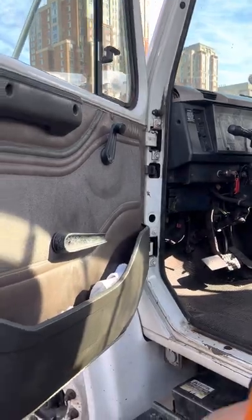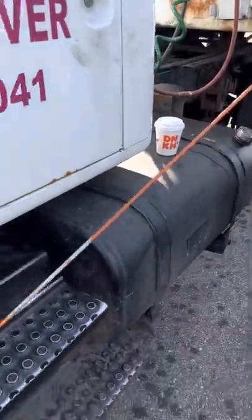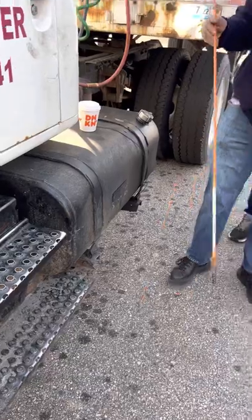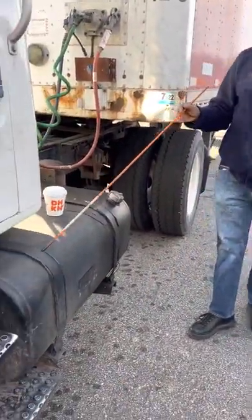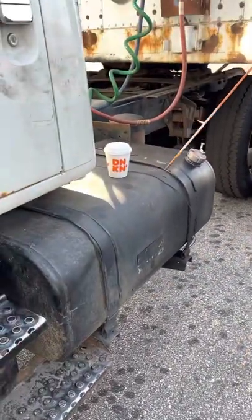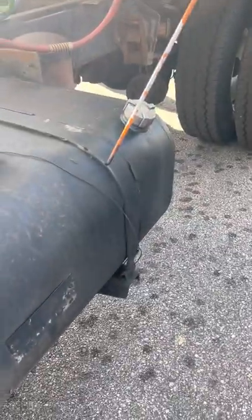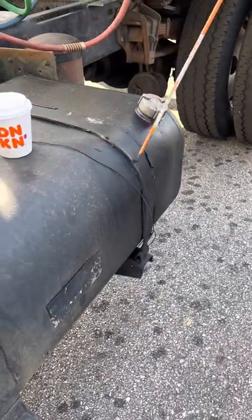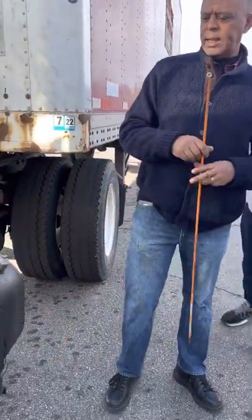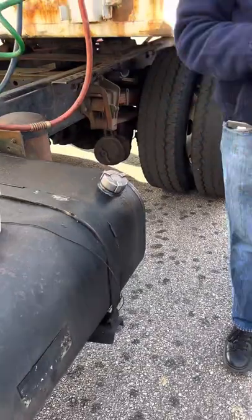The door has to open and close smoothly. This is the steps — we need to check: no oil, no grease, no slippery; it must be clean and clear. We have fuel tank here — we need to check the fuel tank for the leak, make sure there's no leak under the fuel tank. We need to check the fuel straps — if you see any kind of shiny metal, that means the strap has the indicator that the straps are loose. Make sure it's not leaking. This is a fuel cap — we need to check the seal inside, and the fuel cap itself has to be tight and secure.